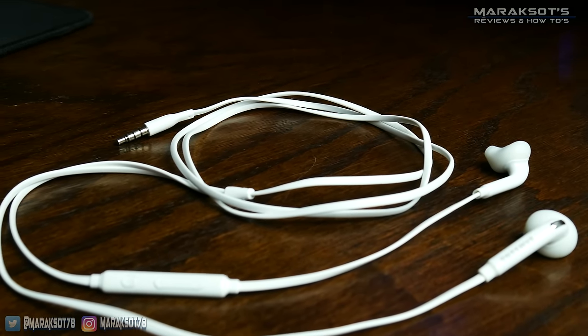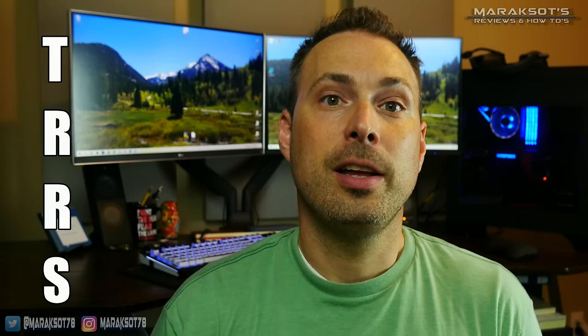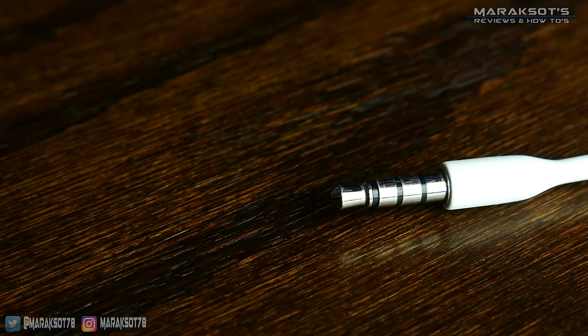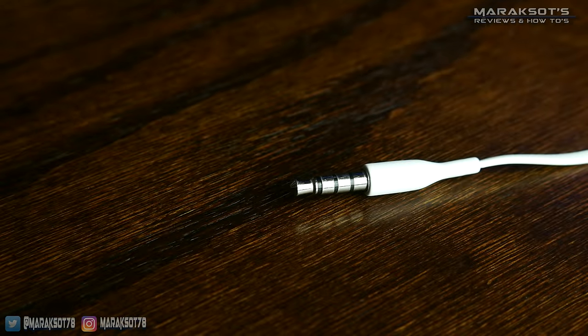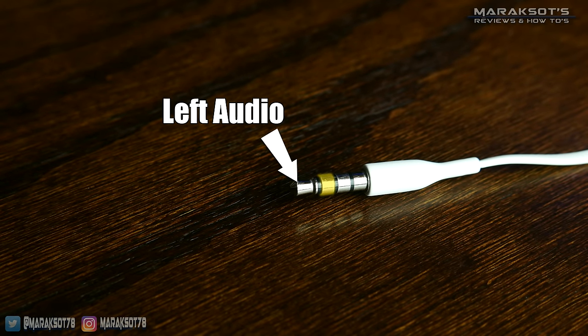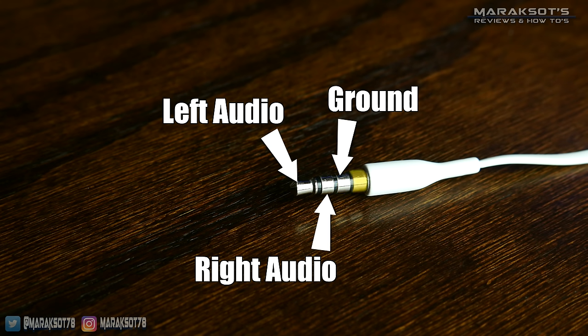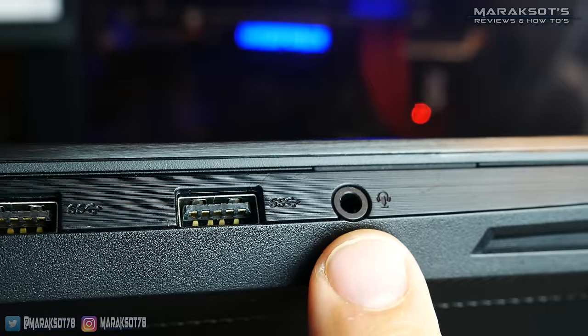What many people don't know is there are more than one type of 3.5 millimeter audio connectors. Many modern headsets, including ones like this one that came with my smartphone, use what is known as a four pin or TRRS plug. TRRS stands for tip ring ring sleeve, and refers to the pinout on the 3.5 millimeter connector. When we look closely at this type of connector, you can see it has four metal portions divided by little plastic rings. The tip carries the left audio channel, the metal ring below that carries the right audio channel, the next metal ring is the ground, and the sleeve is the mic.